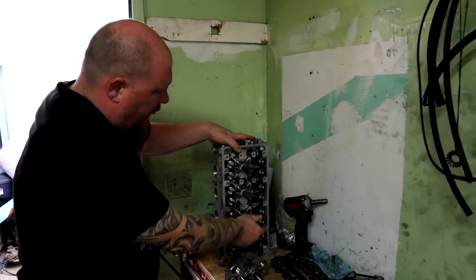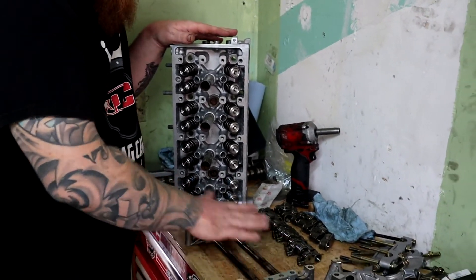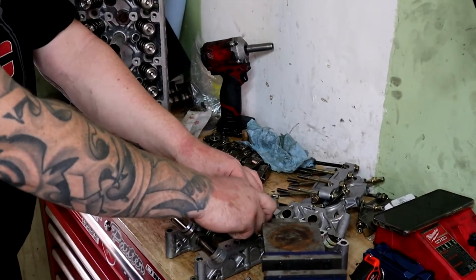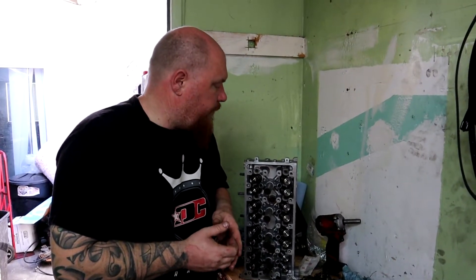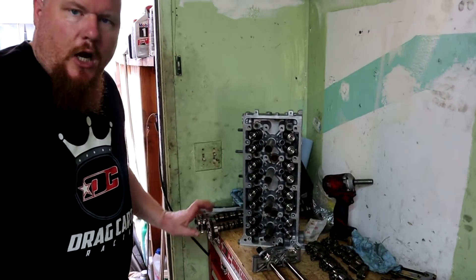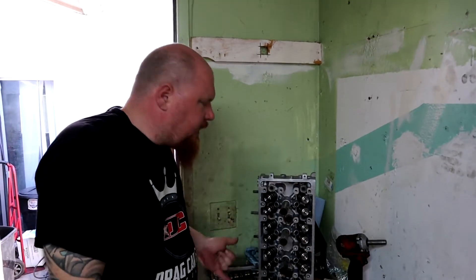I got the head all cleaned up and put some helper springs — mock-up springs — so we don't have to put a lot of pressure to make these valves move. I gutted the rocker assembly; we have all the rockers right here, and I'm just going to go on cylinder one with two pins in here to lock those together. We're going to throw the head on, throw this on, and rotate the motor over and check how everything clears. I'm also just going to be running some K24 stock cams. The engine didn't really like the stage one cams because my turbo manifold is so short — too much overlap since those are all-motor cams. So I'll just run some Honda cams; I've had pretty good luck with those and it should get me to where I need to be.